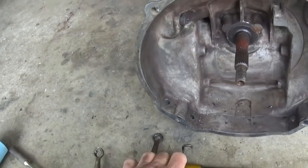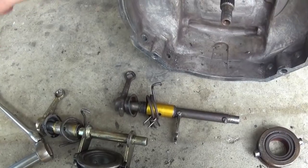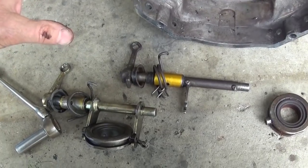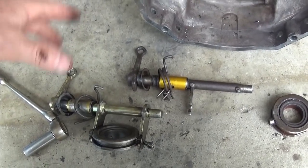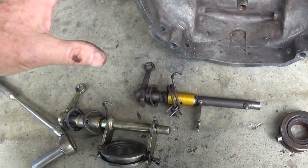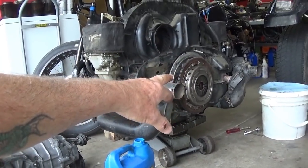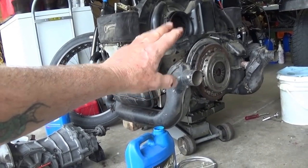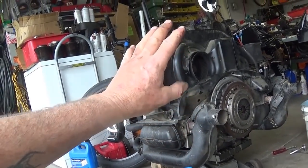Now, if you are using a heavy-duty pressure plate, and my car has a Kennedy Stage 1 pressure plate, which I've just taken off, when you start going high-performance and high-pressure stuff, and you drive it on the street easy every day, day in, day out, you've got to expect that you're going to have some problems. I found a stock late model pressure plate, and I've got it on this 2-liter with 8.5-to-1 compression, light flywheel, dual Weber carbs, mild cam, and it's a 2-liter.